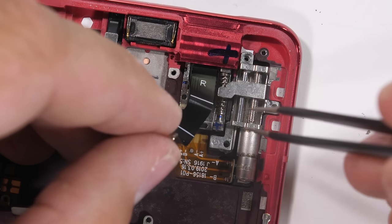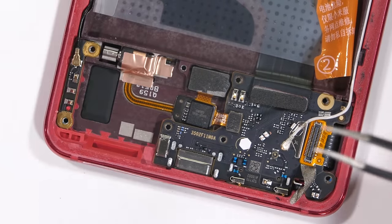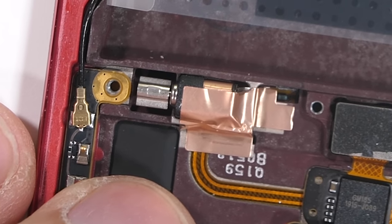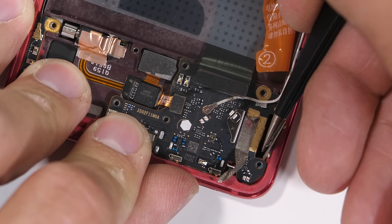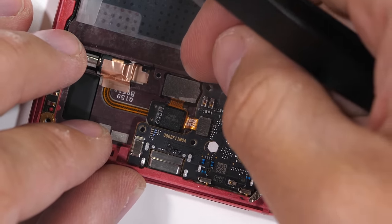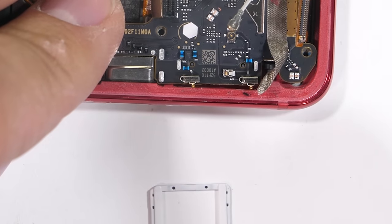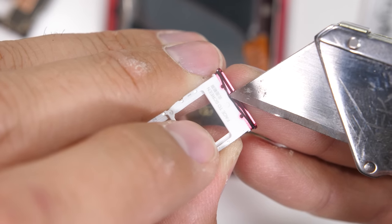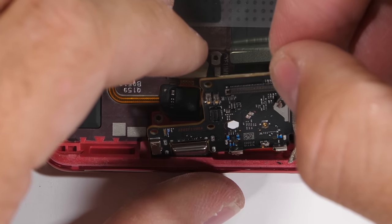I'll get the motor situated back into its grooves in the metal frame. Then let's see what the K20 Pro has down here at the bottom. Right off the bat we see the old school rotating mass vibrator motor. I can unclip all the attached ribbon cables, and there are no screws holding the bottom board in place, but for some reason it still won't come out of the phone. On a completely unrelated note, the dual SIM card tray is down here, and it also has a very thin rubber ring around the base to keep water and dust out. And now magically, the charging port board is ready to come loose.